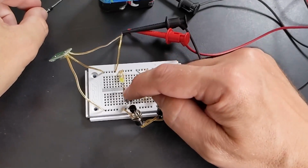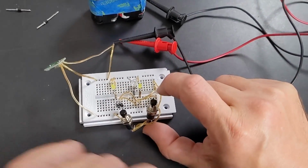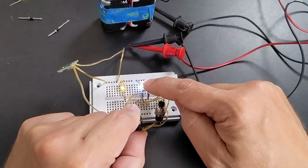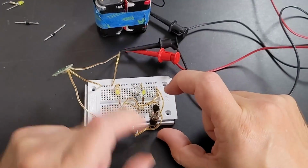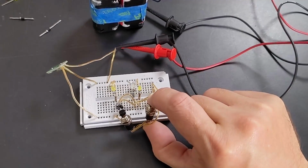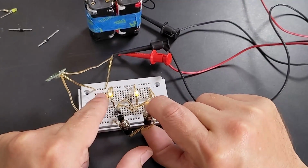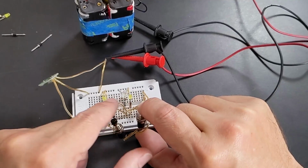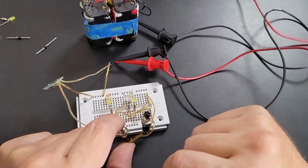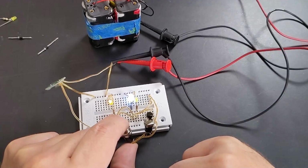I've got two of these now installed right there. So we can see when I press the running lights on, only the running light and the side marker come on. The turn signal is now isolated. And when I operate the turn signal, also the turn signals are isolated. So, hey, fantastic. My turn signal operates both the running lights and the front light, the front blinkers, and the running lights activate both the side marker and the front running lights.